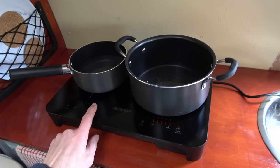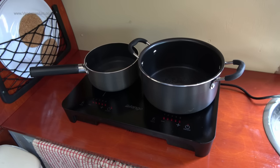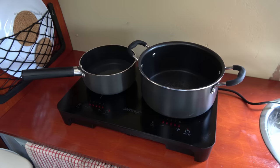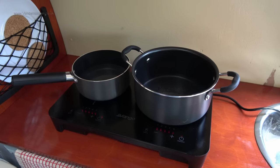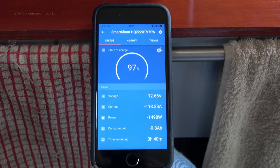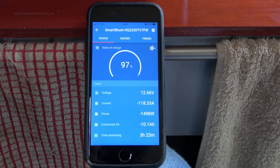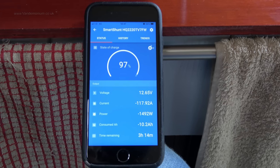Hooray! Here's the big test - both of them on. 800 watts each. I'm surprised it ran for so long; after I turned them both on, the fuse must have gently melted. We are up and running again - one might almost say we are cooking on gas, except that we most definitely are not. 1500 watts going, 118 amps. Bear in mind that given my culinary limitations, it's extremely unlikely I'd ever have both burners on. This is actually quite an extreme test for my kind of cooking in the van.